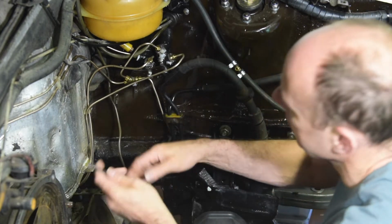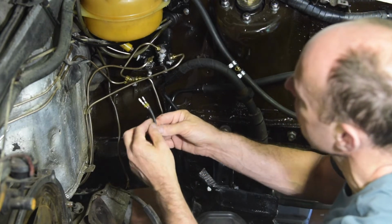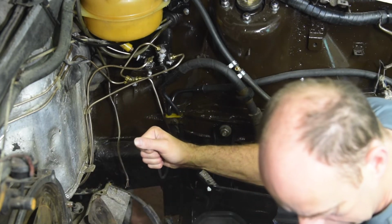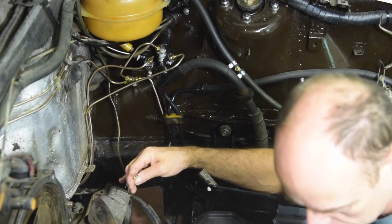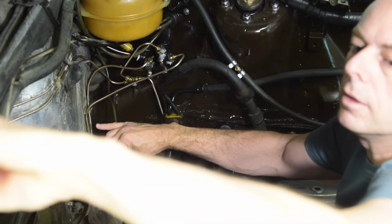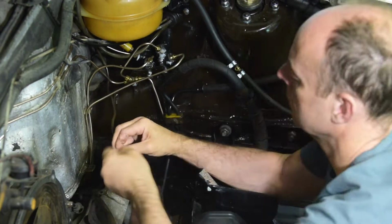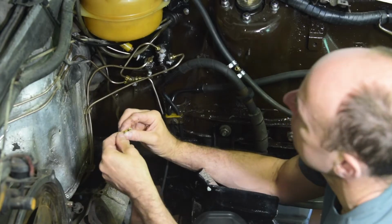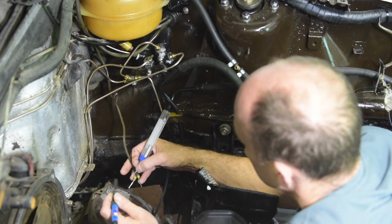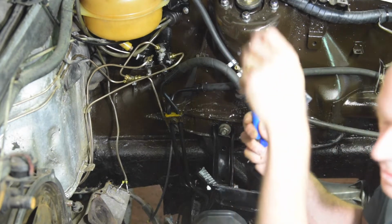So all I've done then is I've put the new brake pad wear sensor through the firewall, whatever you call it, this side of the engine bay. Put the clips on, so that's ready to have its connector put on. Now all I need to do, they're 2 female, so now all I need is 2 male on this side for my wire strippers. So we'll quickly wire strip. Okay, right, that should do that. Now, all we need to do now is fit it all together.